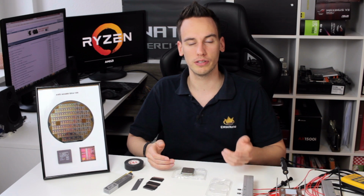First of all, AMD Ryzen CPUs are soldered. So it's not really recommended and also not really necessary to delid the chips, because there is no conventional thermal paste underneath the IHS. So please do not try this at home, because I want you to keep your chips alive. Before I did this video, I already tried to delid two other chips and both of them died. So as I said before, please do not try it at home.